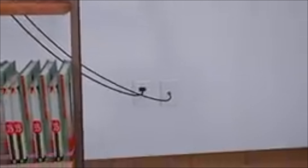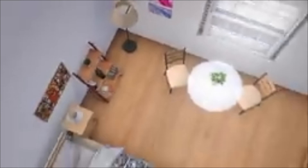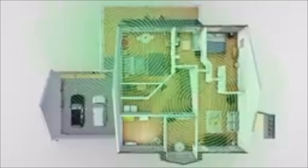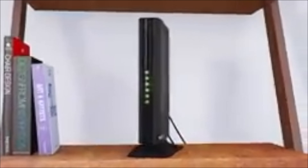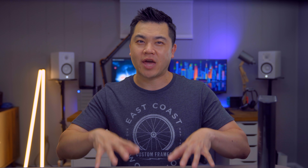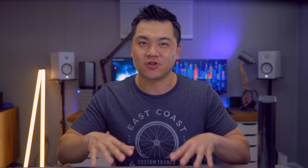If you're a Verizon customer like I am, you can either buy outright or rent it for a monthly fee, much like you do when you rent a set-top box. Mine came with the extender itself, a splitter, and a coax cable. Installation is super simple. If you already have a TV in the room, all you need to do is take that coax cable, plug it into the single end of the splitter, and one goes to your box and the other one goes into your extender. If you don't have a set-top box or don't plan on using one, the coax cable can just be plugged directly into the back of the extender. Plug in the wall adapter, and the wiring is done. It really is that simple.